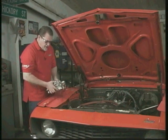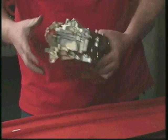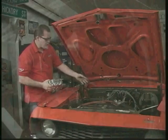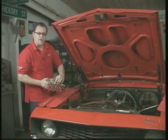Before you do, just give it a once-over. Make sure there's no packing debris inside or anything like that. Take note that there's a vacuum port on the back side — the front side is for the PCV valve, the back side is for power brakes. Now our car here uses power brakes coming off the intake manifold, so we're not going to be using this port, so you want to be sure you block that off.